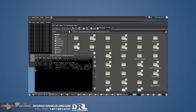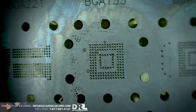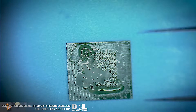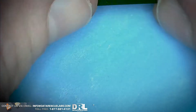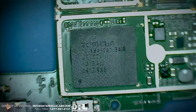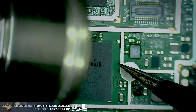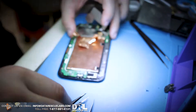I'm not going to take this chip into UFED in this video — we've done that too many times and if you're a viewer of this channel you've probably seen it tons of times. Now we're going to reball the chip. Reballing is pretty simple and straightforward as well. The chip is reballed. We bring the motherboard back and put the chip back on — just need a tiny bit of flux so we don't want the chip to float away. Low heat, just enough for the chip to tack onto the motherboard, and there it is — chip done.